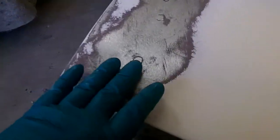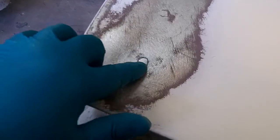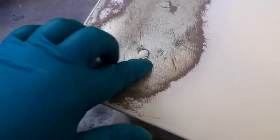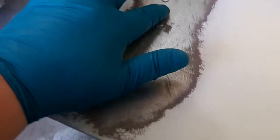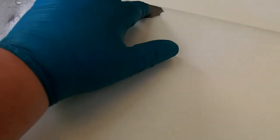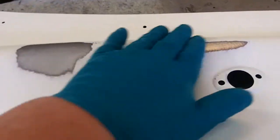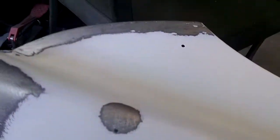This is what she looks like. I've got a bit of a channel here that I've got to fill. You can see where all these plug welds are — these were actually slide hammer drill marks that they'd actually tried to pull out before. So anyway, I just filled those and we're going to put a thin coat of filler over that. I've got a small dent here, a small dent here, just a little bit of something there, and a little filler across the top edge. So that's it for this door. I'm going to mix up some filler and we're going to fill this and give it a quick sand.